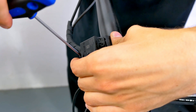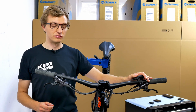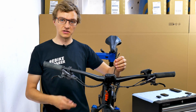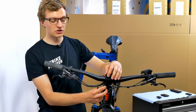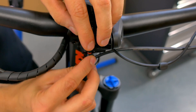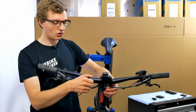The screw and the safety plate are included in the scope of delivery in any case. Once you have firmly screwed the display mount to the holder, it is now time to connect the display mount to the e-bike and the LED remote. First of all, make sure that the electric bike is switched off. You can simply pull out the cable of the LED remote, which is inserted from the right side. This is the cable that comes directly from the motor. Now that it is still a bit movable, we can simply plug it into the display mount, into one of the two connections — it really doesn't matter which one you use. Look for the white marking, which can also be found on the connectors, and with that you can plug it in safely. The cable is laid here in the frame and we can push it a little further into the frame to avoid it being too long and hanging loosely out of the frame.